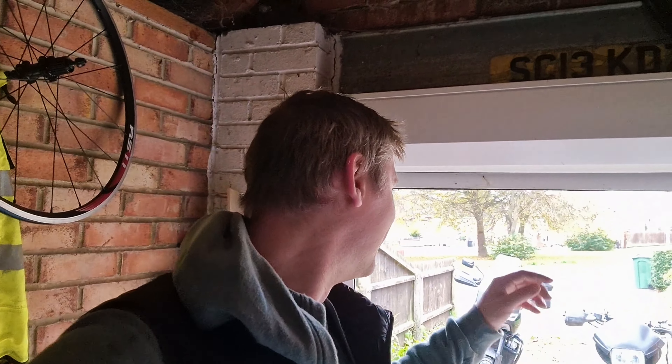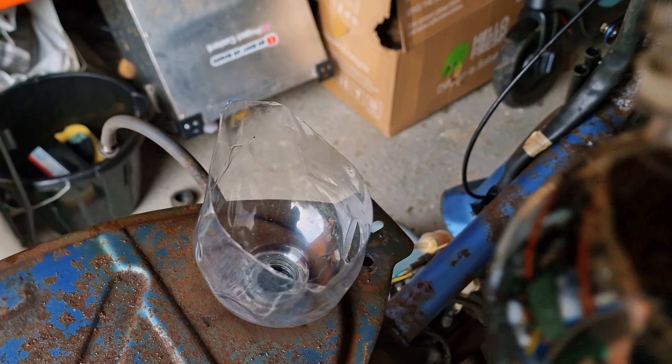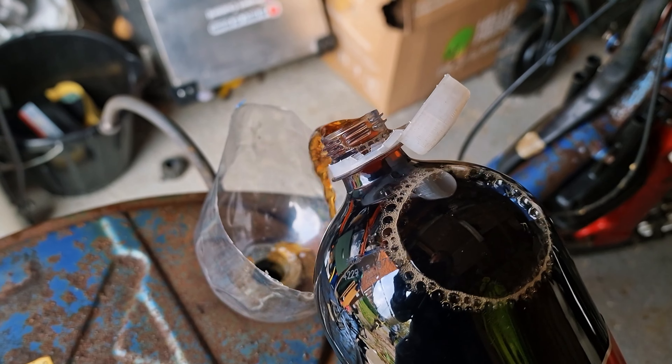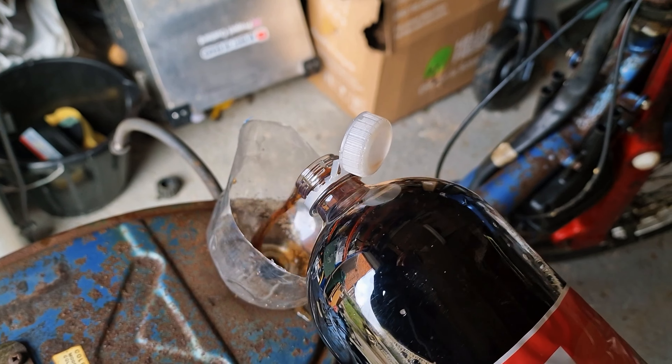I'm also going to clean the carbs out again, make sure they're completely clean, then run a fuel line from a clean vessel — like one of my jerry cans — down to the bike and see if it'll tick over and run that way. If it works like that, I know it's probably the tank and the tannins. If not, it could be something else — spark plugs have been changed, so it could be something to do with the engine itself, whether that be the valves or what have you. With the C90 I'm still learning — I know nothing about them. It's just a bike I've always wanted and got an opportunity to buy. Here we go then — filling the tank with cola. One bottle down, one to go.